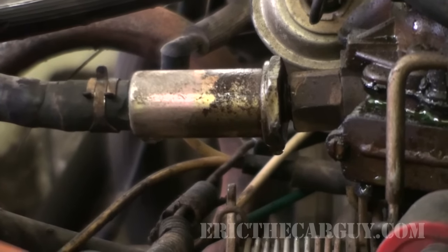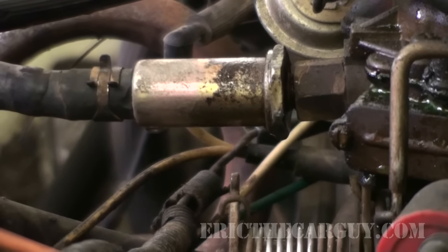The other day I'm driving and I kind of smell gas. I popped the hood and lifted the air cleaner only to find that the fuel filter is leaking a bit of fuel under the intake manifold. Kind of dangerous and not really good for the gas mileage.